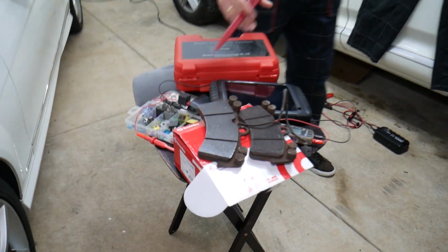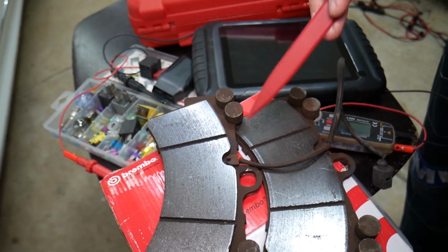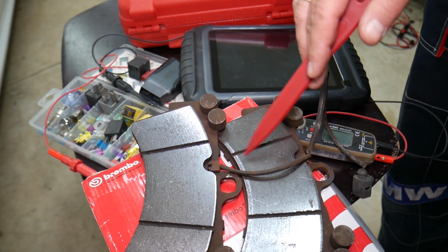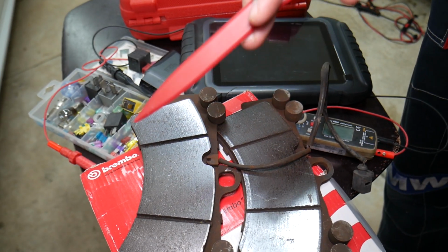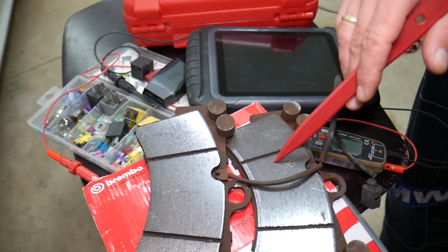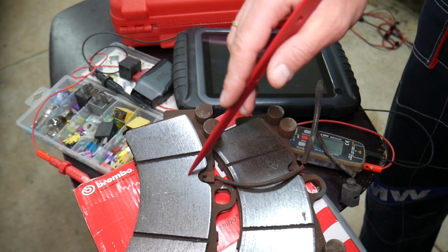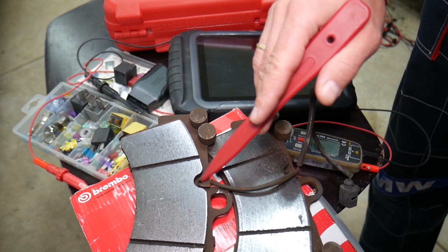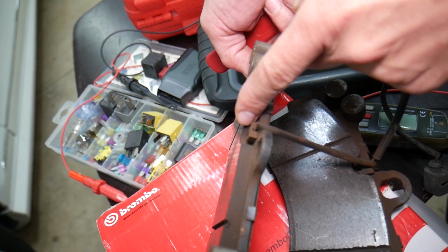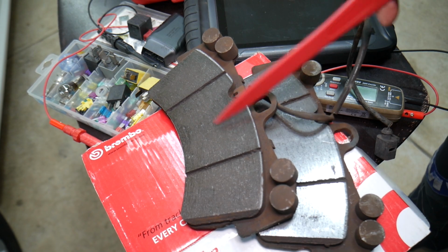You see these brake pads, on your Mercedes they will be similar, not quite humongous, but similar. On most cars, you're going to have a brake pad wear sensor on one of the front wheels and one of the rear wheels. Now, this is out of a Porsche. It has a double sensor on the inner and outer brake pad, but most Mercedes or BMWs will have one sensor. And when you wear the pad out to a certain point, it's going to contact that sensor. That sensor will wear out. It will break the connection. You'll get that light.